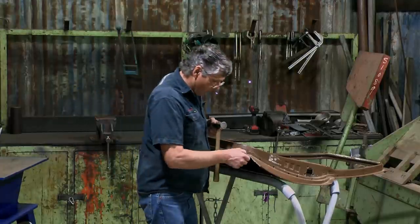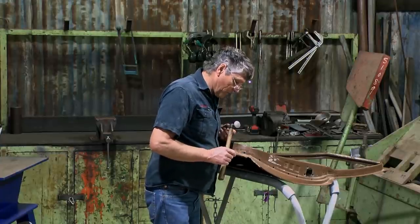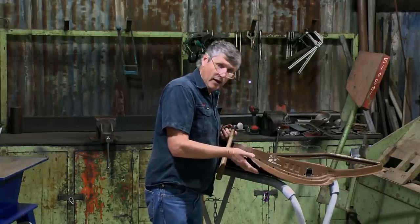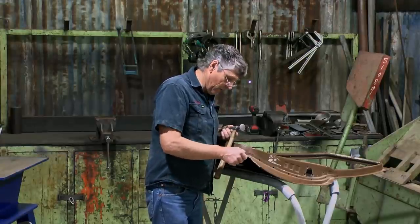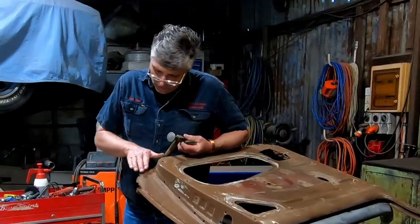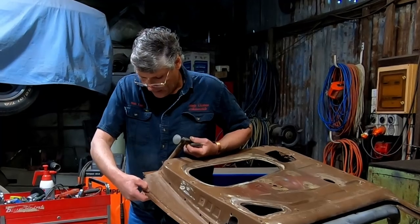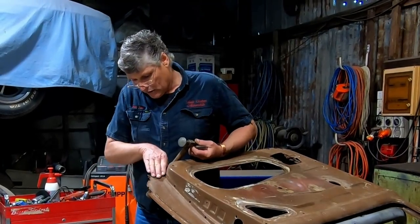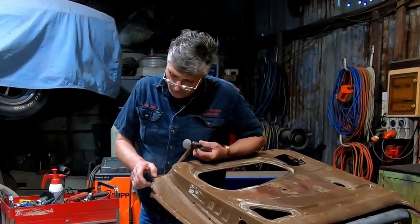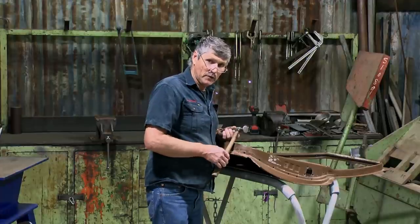For today, we might look at getting this back corner done in the frame, and that'll work better for us time-wise as well. This one's rusted away and we will have to make a new piece naturally. These are an easy piece of metal shaping for a novice — this is where you can really start to have a little play about getting some shape into the metal. We've got a little bit of a curve area across here, a little bit of a recess and a step down here, and it curls down on this side. The whole lot will come into a point somewhere around 30mm, inch and a quarter or so, from where the rust is.